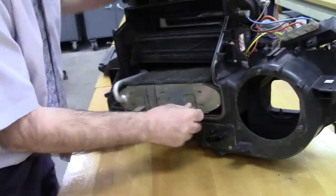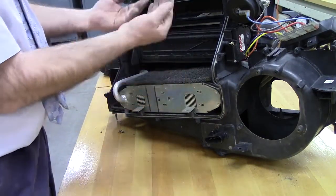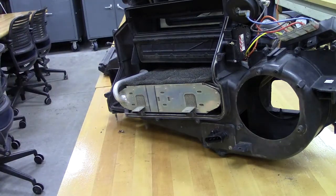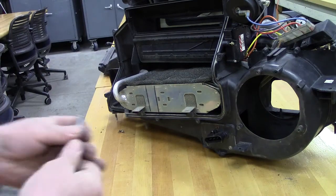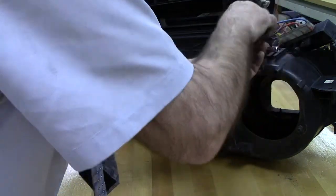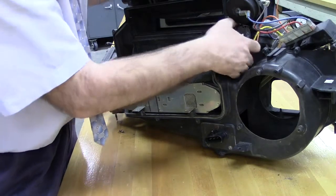For air conditioning, we have the ability to either send cold air into the automobile or make it come up and over for hot air. To do that we have an electric motor on this one. I'll pull this pin out and we'll see what it does — it electrically changes positions to give us either air off of the air conditioning or air off of the heater core.